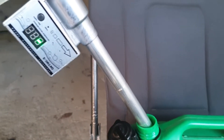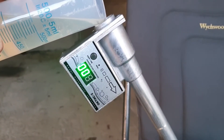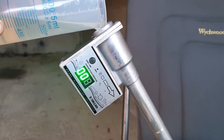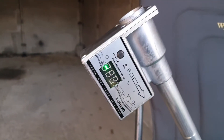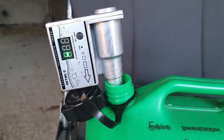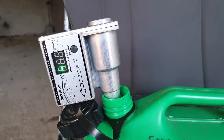Now I'm not confident this will work but I'll try pouring petrol through it. Apart from making a mess, I think the seal here means that a steady air-free flow of pressurised petrol needs to be passing the sensor, as I'm just getting a fresh air zero reading. While it's still scanning let's put it back into the 4 litres of petrol. Yep, 93 again — so it does seem to be reading consistently.